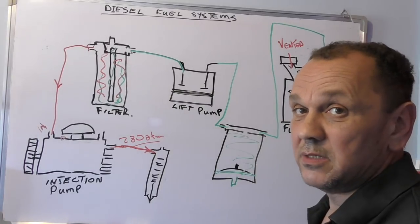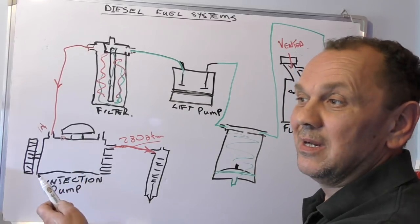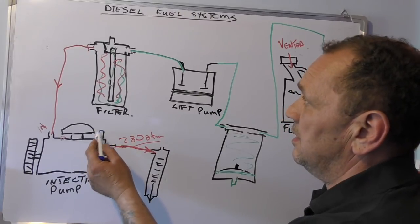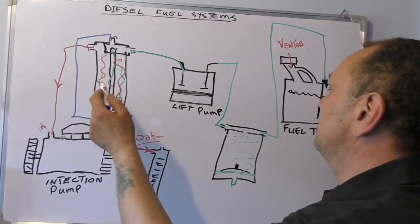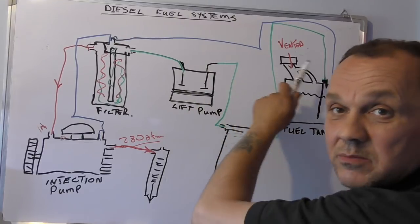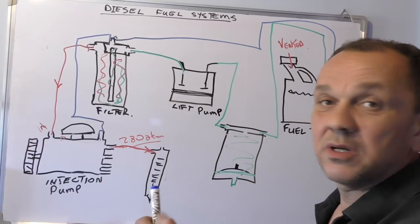Before we talk more about the injector, diesel fuel is also a lubricant for the moving parts. At one time when diesel had sulfur in it, it was a good lubricant, and then they took the sulfur out. Now what do we have? About 5% vegetable oil or something. Basically you need a leak back — what this does is leak the diesel back to the fuel filter and also back to the tank, where it drops the diesel back in. It actually comes out warm, because any fluid that's been pressurized will be warm, which is good because you want a certain viscosity of diesel for it to work properly.